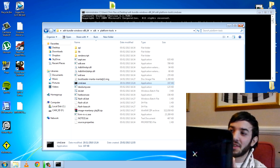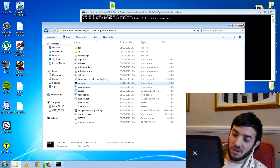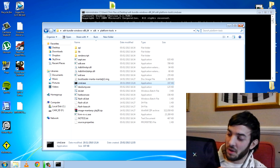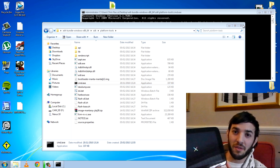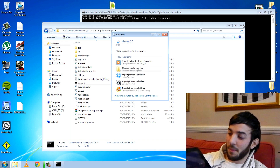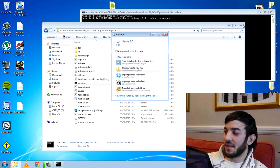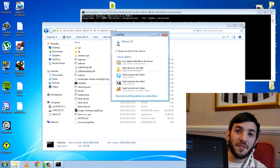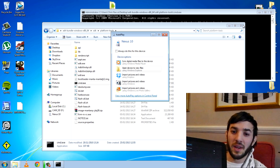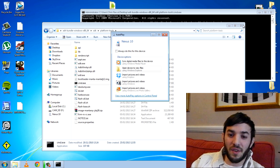If you get into any trouble or stuff doesn't start working and you just want to start the whole thing over again, use Fastboot — flash the stock image. You'll be back to stock Android, obviously unrooted and with a stock recovery. Everything is stock. And there we go — this is Android, and there's the start screen. The bootloader is still unlocked, so you can go ahead and flash a custom recovery using Fastboot. All you have to do is 'fastboot flash recovery recovery.img' — just the name of it. And you're good to go. That is how you use Fastboot. I hope that's answered a few questions. I hope you enjoyed it — see you guys later.